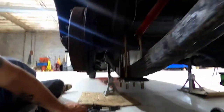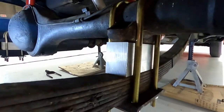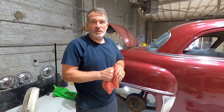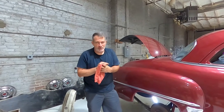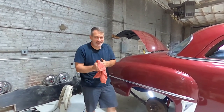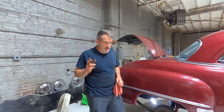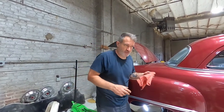That's the installation — pretty straightforward. The beauty of it is if you don't like it, you can put different blocks in there or take the blocks out and put it right back where it was. It really is nifty and it didn't cost that much. The blocks from the metal supply, cut to the right length with the cap screws in — it was under twenty dollars. A real simple and cheap way to do a mild custom drop on a Chrysler of this year or different products from the 50s. We'll put the tires back on and do some measuring.